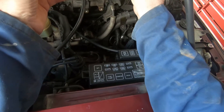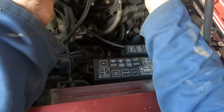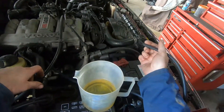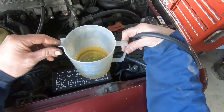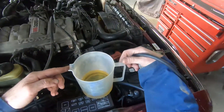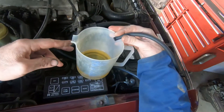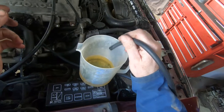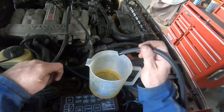Have a look — maybe 300 mils if I was feeling really generous. So that's 600 mils a minute, times 60, that's 36 liters an hour. That isn't going to run the engine very well at all. On this vehicle I'd like to see 100 liters an hour; if it was a V8 Lexus I'd want to see 120. So basically that fuel pump has an issue — it most likely needs to be replaced.